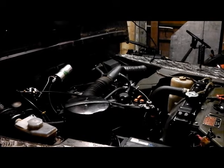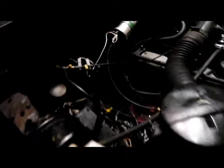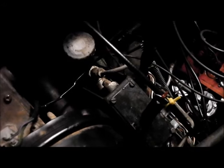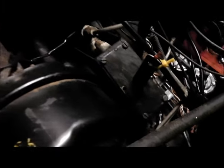Hi folks, we're back in the workshop with the Land Rover again and today's job is to do the clutch master and slave cylinder. Here's the master, and first things first, we're going to take the entire pedal tower out of the vehicle rather than trying to get that out the back. You can see there's virtually no clearance between the bulkhead and the pedal box, with a few bits in the way.